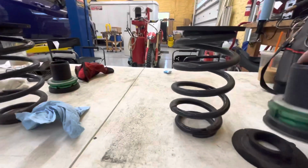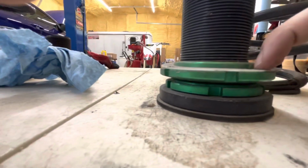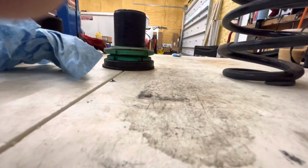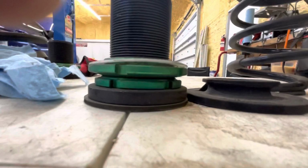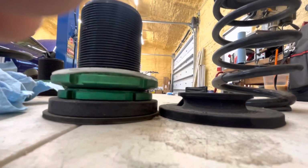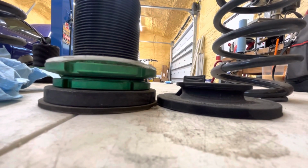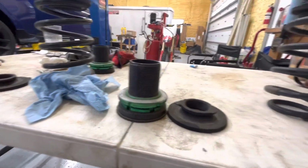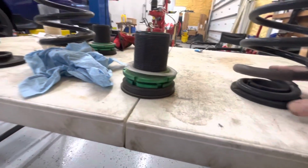Springs off. Those are the spring adjusters that were on there. Now we had it all the way to the lowest setting, which means that the spring would come and sit right here. So it's lifted up from all of that. So I'm going to take that out. My idea was to replace it with this, which if you put it next to that, is going to be a pretty significant drop there. And it's not going to be a direct ratio from here to the wheels. It may even drop more at the wheels. So we'll see what it looks like. I don't think it's going to rub, so I think it should be pretty good. Basically, we're just going to take this and set this on top of there and spin it to the right spot, but you get the idea.